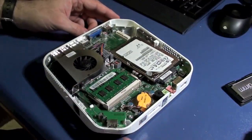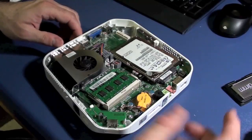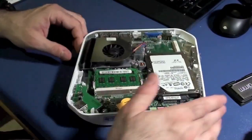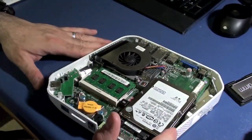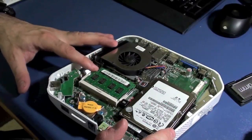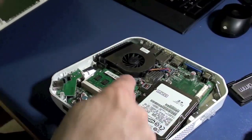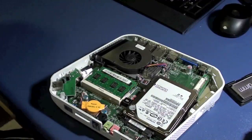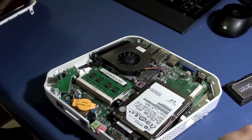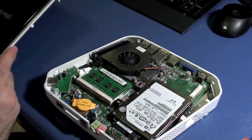It's similar with laptops — it's actually easier with a laptop because you usually just turn it upside down and on the base you remove a panel, then do the same thing since this is laptop memory. The memory in the Revo is DDR2 at 800 MHz, non-ECC — cheap stuff. This costs $17 with a dollar shipping, really cheap, at one of my favorite places to get components, Newegg. I also sometimes check Tiger Direct to see if they have any better deals.